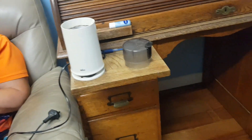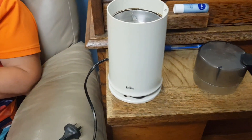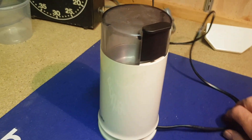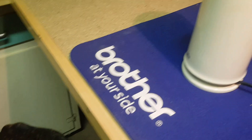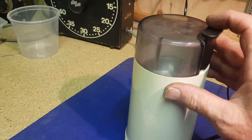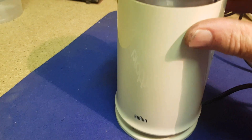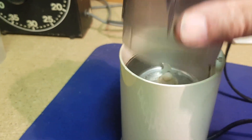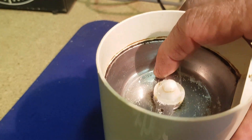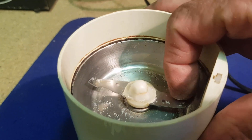Maybe not chalk or coffee — maybe smaller sticks of chalk. Anyway, I'll take it out to the workshop now. Out in the workshop, it's a bit quieter. Now it's very very tight. I've just plugged it in and if you push this down it should buzz and spin the blade, but all we're getting is a hum. So it's seized up — whether it got hot and melted something or chalk got down into the bearings, I don't know. We'll pull it apart and see.